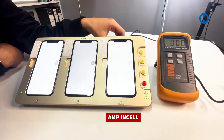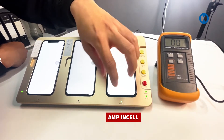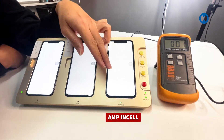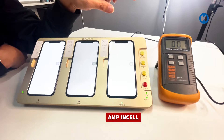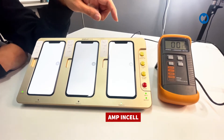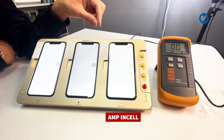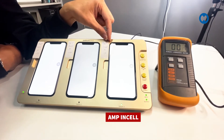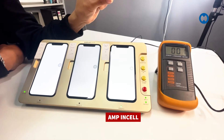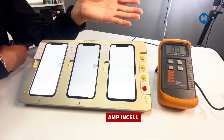The reason AM Plus is brighter than normal is that it uses LED tubes running like a turbo to boost brightness, but this causes the LCD to consume more battery. When using this display, your battery life will drain more quickly than normal. The display is also thicker than the original — it's made of three layers: LCD, backlight, and glass on top. When you fit it into the phone housing, it sits a bit thicker than normal, and your customer may say the screen doesn't sit properly.